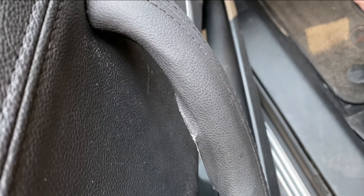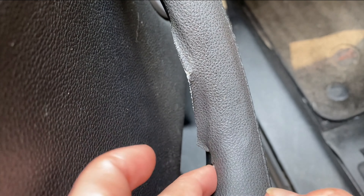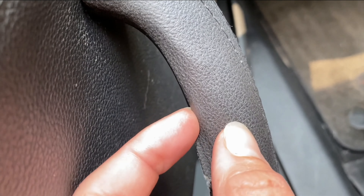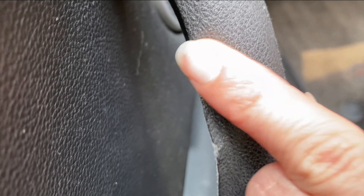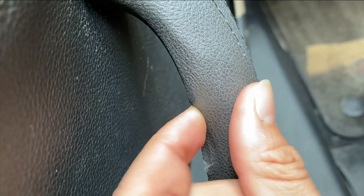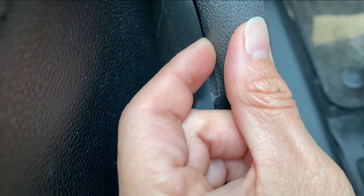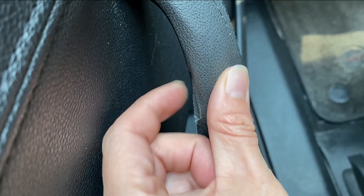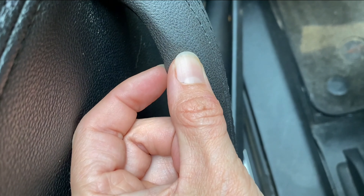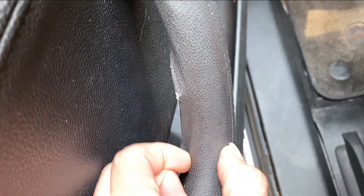As you can see right here, this handle has a lot of material pulled out. It's actually been torn just a little bit right there. You just want to wrap over and pull over the material, then start tucking. There's a little plastic ridge that you can feel with your fingernail and you just work it over time, just like that.